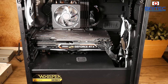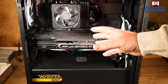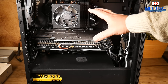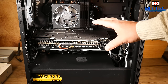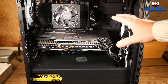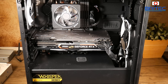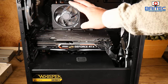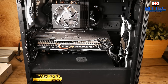Next consider overheating. The problem I'm mainly talking about is when the PC shuts off within three to five seconds. If it's getting to 20 to 30 seconds before shutting down, it could be an overheating issue — check for dust build-up in the fans. Overheating is commonly related to a heatsink that has failed, causing the system to crash, so make sure your heatsink is working correctly.